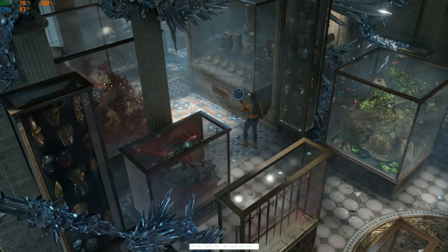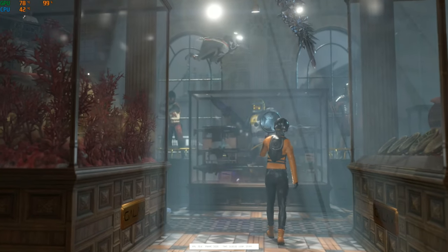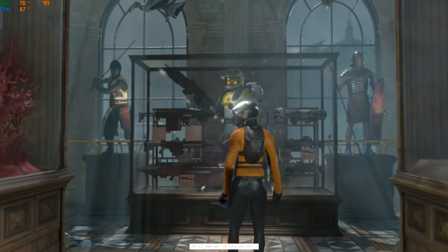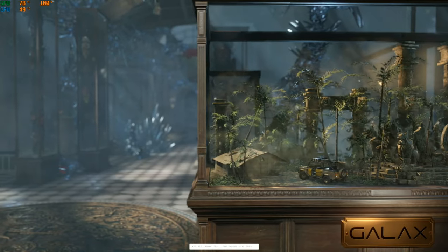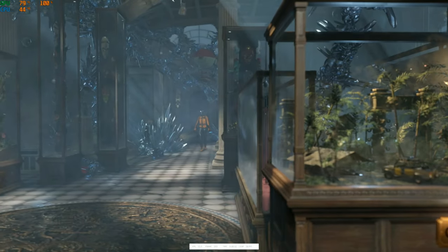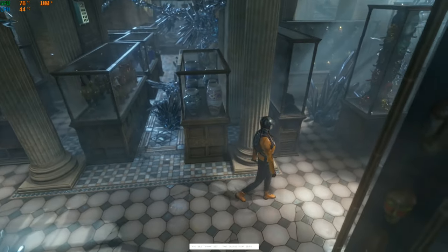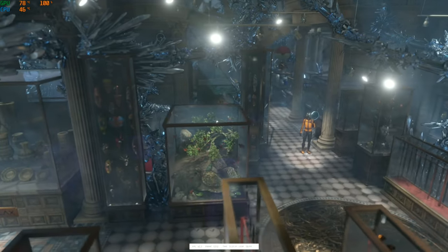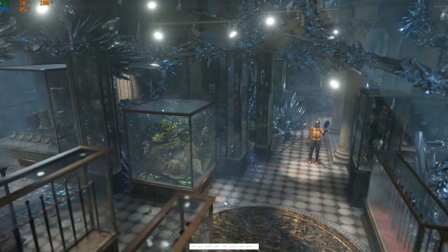All right, so we are testing with TimeSpy Extreme, and you could see with the EVGA GeForce RTX 3080 Ti FTW3, we're going between 79 and 78 degrees. We've been testing now for about 33 minutes, and the CPU is between 44 and 46 degrees. CPU is not used very much here, but before, when I had the liquid cooling unit, the radiator up at the front, the card quickly surpassed 81 degrees within 5 minutes. So I took that out and quickly changed up here.